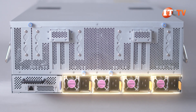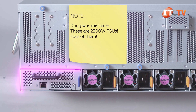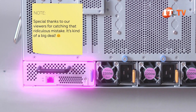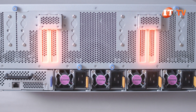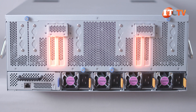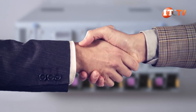On the back of the system, you'll notice four PSUs lined up along the bottom of the chassis for redundancy. These are the big ones at 2200 watts of 80-plus platinum power. Right next to the last PSU is a small hot-swap pullout LAN module that features an integrated gigabit network port and a slot for an optional OCP card for other network connection speeds. Four low-profile slots above the PSUs are for additional networking. If you want to get the most out of this system, you're probably going full 100 gigabit Ethernet with InfiniBand by Mellanox. NVIDIA just purchased Mellanox, so we can safely assume this partnership will only lead to greater levels of performance.